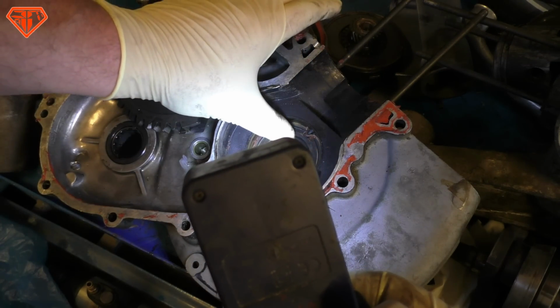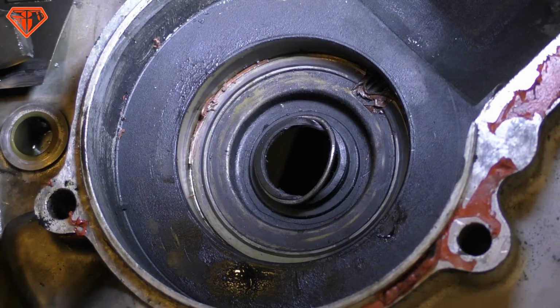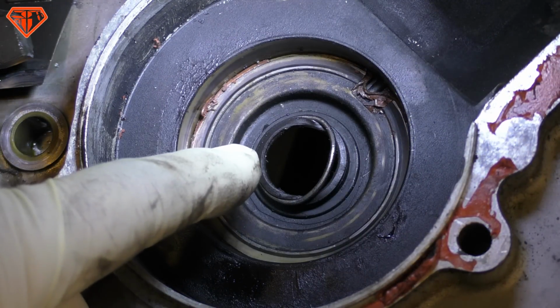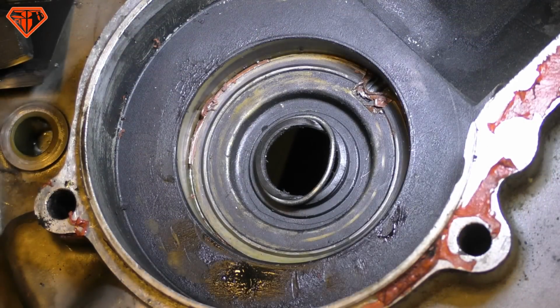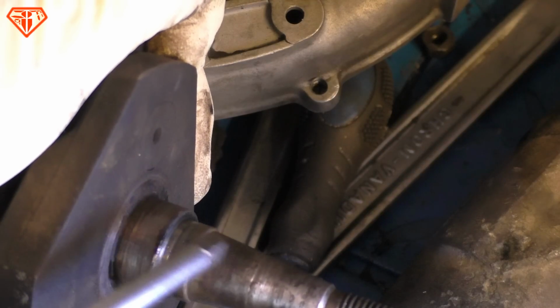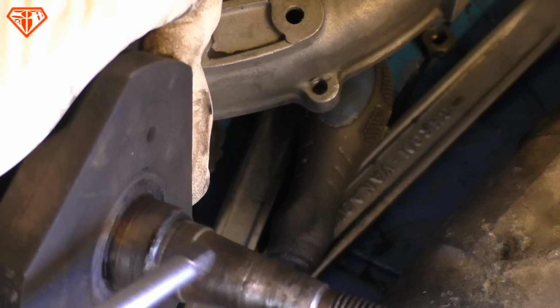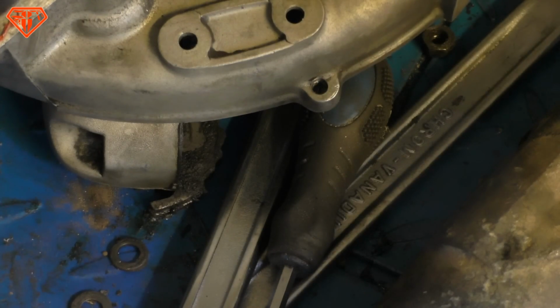The spring of the seal, based on the marks on the lip of the seal, it was sitting like that. Was there for a longer time. And how did that happen? This happens when you have these old crankshafts. If you do not put an additional plastic here or a metal shoe, then this lip will lift out the spring, and that's what happened here.